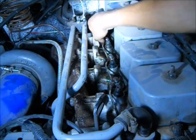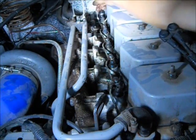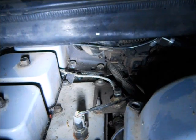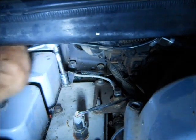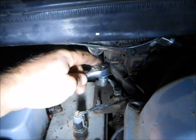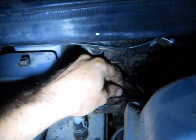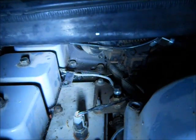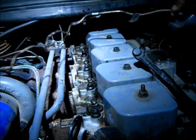We're going to do the last three. There's also the bolt back here for the injector return line — 10mm — and the 12mm injector return line banjo bolt, which typically hooks into the fuel filter. Just take it out; it's got rubber banjo bolt seals on it, so don't let them fall off. Now we just pull the injector return line off — it should come right off. Up and out.